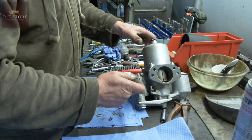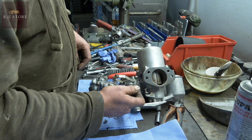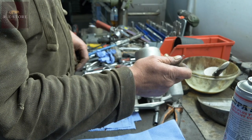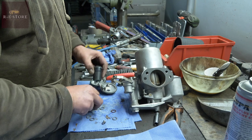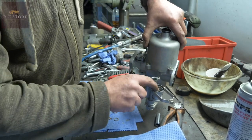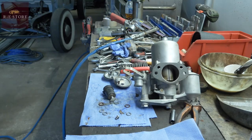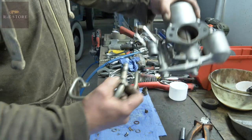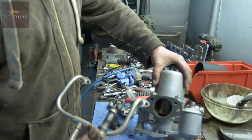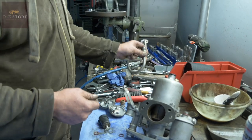This is a starter carburetor - you don't have a choke as such, or an automatic enrichment device as they call them. You have a switch on your inlet manifold, a thermostatic switch, so when that fires it fires that solenoid there, opens that valve through that hole there, and then passes neat fuel from the bottom of here through those two, goes in there straight into the inlet manifold. So it's firing neat fuel straight in, instead of a choke flap as such. The earlier ones had six on them, one for each piston, but the later ones had two.